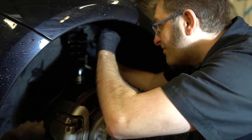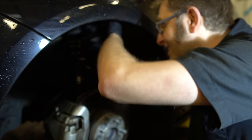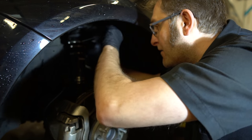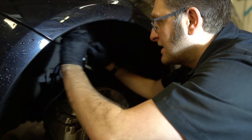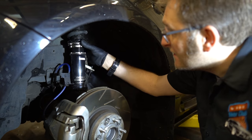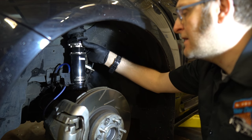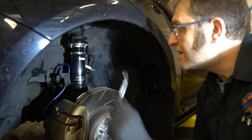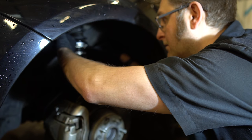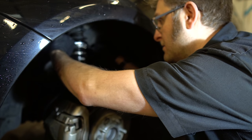I can't get in there with him — it's a small space. There are four wheels to do, so we can do two each. They are coming down now. I took 10 mil off, bring them together and tighten them up to lock them, then see where she sits. It wasn't really preloading as much, so maybe we will get a full 10 mil. We'll measure the difference and replicate that on the other side — nice and even.